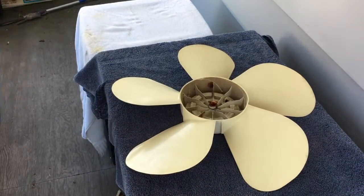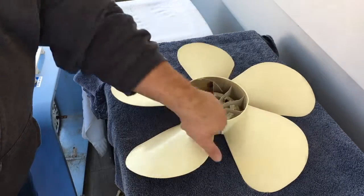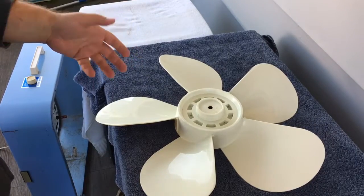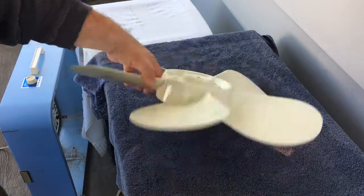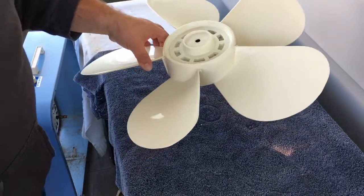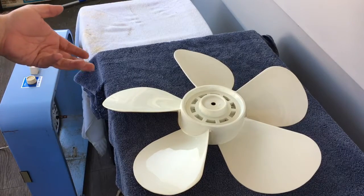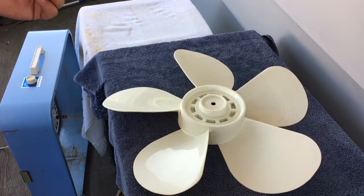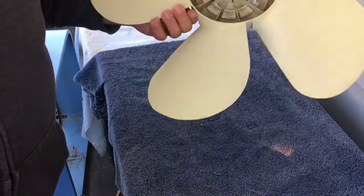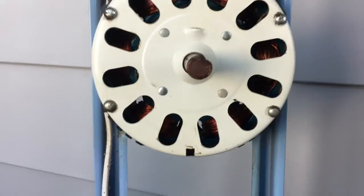It comes right off. The point of today is just to get the motor and oil it, but I might also wash some of it to clean the case out. The grates are a disaster — very brittle from age. One of the drawbacks of this design: the cool-looking fans, but the grates get brittle over time, especially if they were left in the sun. This one for sure.